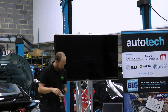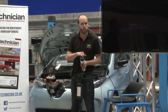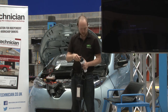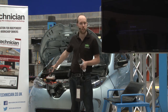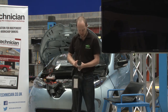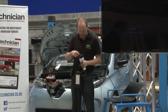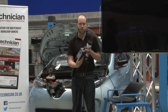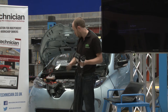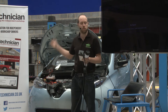On our single phase we've got live and neutral, and you'll see we've got two small pins at the top for our control. We've got what we call a proximity pilot, which just tells the car it's plugged in — when that's plugged in it won't let the car start and drive off, because obviously we'd be dragging the house down the road. We've also got a control pilot, which convinces this box there's a car on the end and therefore it's safe to turn on the supply. It also lets the car know how much power it's allowed to pull from the mains without blowing the fuses.